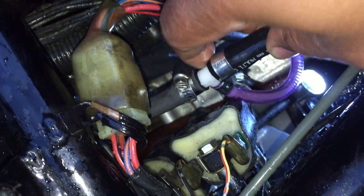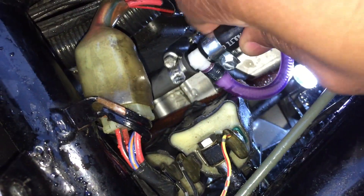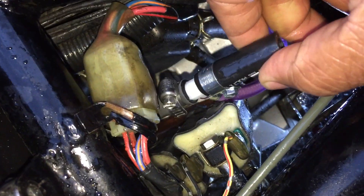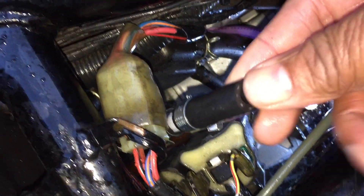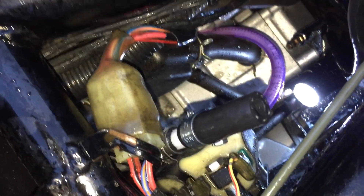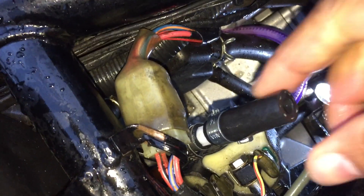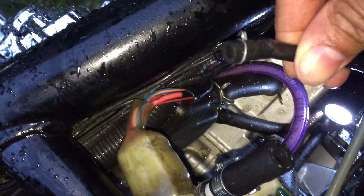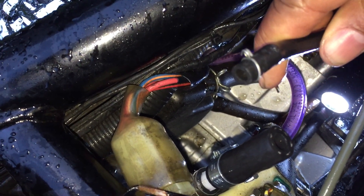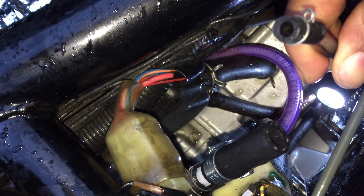The fuel tank is off. I've chopped off a few inches from my fuel line and installed the T-junction along with the hose that connects to my gas tank. Next step: put the gas tank back on, get it bolted down, attach the fuel line to my fuel petcock, and attach this air hose — that allows air into the gas tank as the fuel level goes down so you don't create a vacuum. Just like science class.